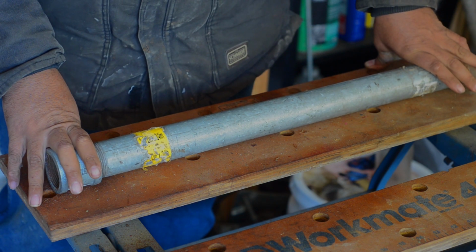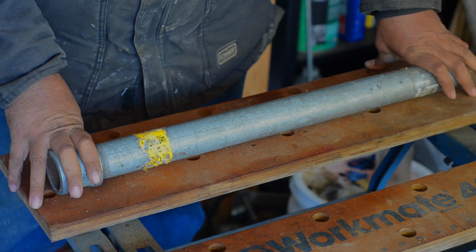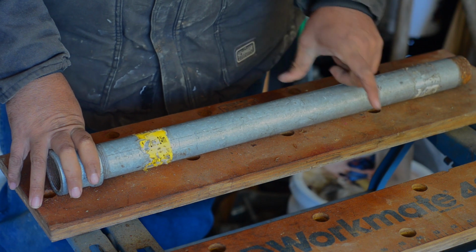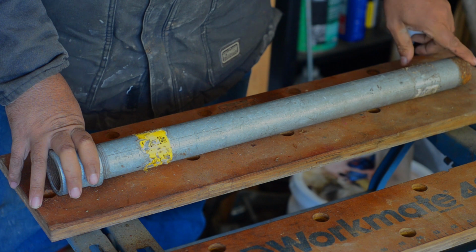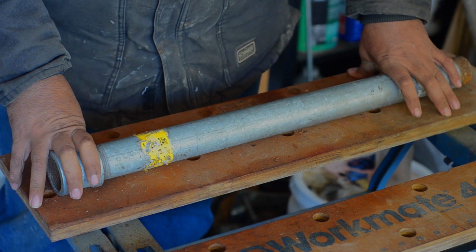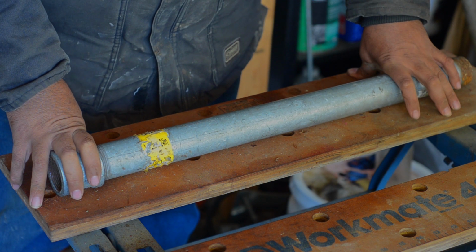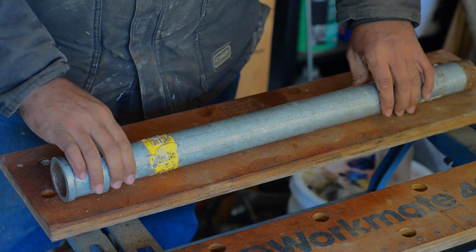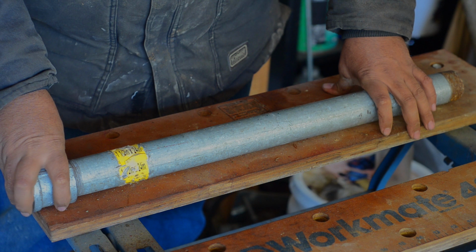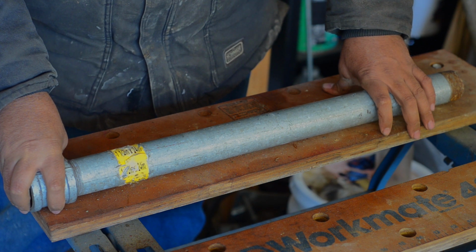Sometimes it's just prying leverage. Of course, again, if you're using a 1/4-inch wrench, super tiny, and you're putting 3 feet of pipe on it, you're going to break something. You're either going to snap the bolt off or break your wrench, depending upon what you're on top of. But the main advantage to these extensions, these pipes, is really to reduce the stress on yourself.